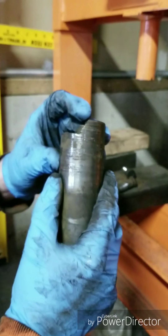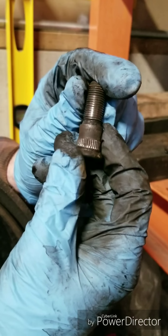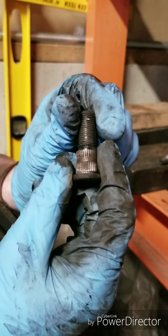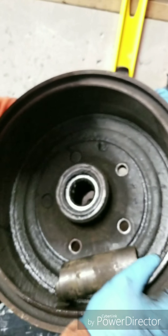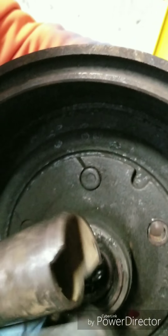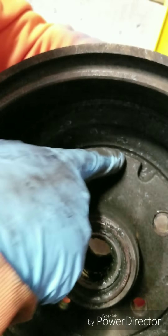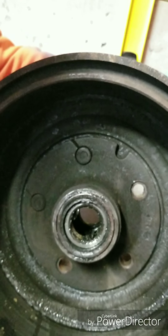This is the piece of pipe we cut, and it kind of curls up on the lip in there. The wheel studs - that top little edge used to be flared out. Sometimes it actually rips the edge off and sometimes it just crushes it back into place. The hub appears to be fine so far. On these ones there's another little notch here, so we're just going to have to recut our brace so it pushes evenly on at least three good points on either side of the wheel stud so it doesn't warp or break the hub.